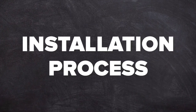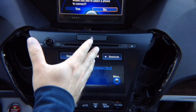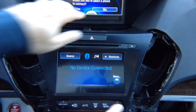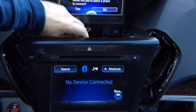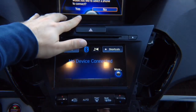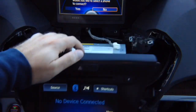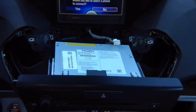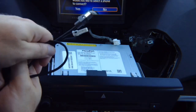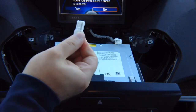Interface installation process. Now that we've programmed the interface, let's remove the radio to access the connectors in the back and install the plug-and-play harness. Pull on the radio — radio comes out. Disconnect the connector in the back and on the bottom — one connector for the buttons. Pull the radio out; it's easier with a friend or just drop it down a little. Take one of the two supplied digital cables and install it at the back of the radio. Find the matching connector — it's going to be gray, right on top in that row.